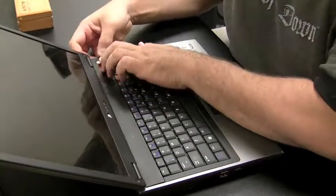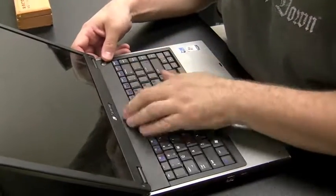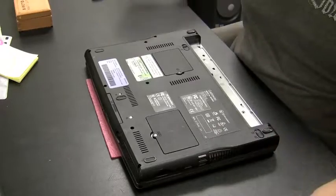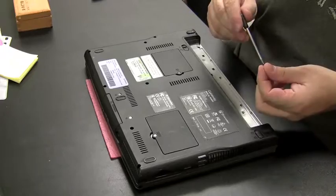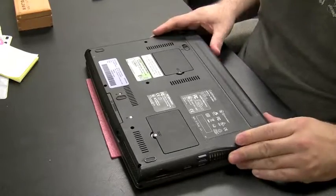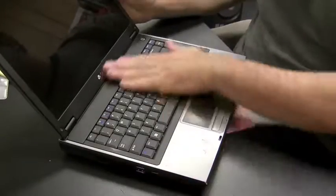It went on smooth. It's a good idea to have the battery out because your fingers are all over the power button while putting this plate back on — you don't want it to keep turning on and off. Make sure it's flush and level. Then flip it around, put the two screws back in, and that's how easy keyboard replacement is. Keyboards are very easy — and that's how you do a keyboard replacement on a Gateway laptop.